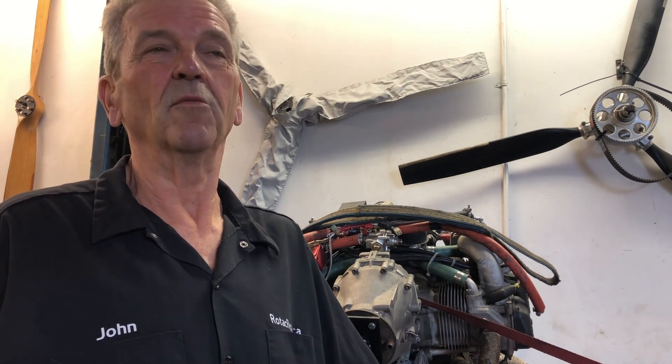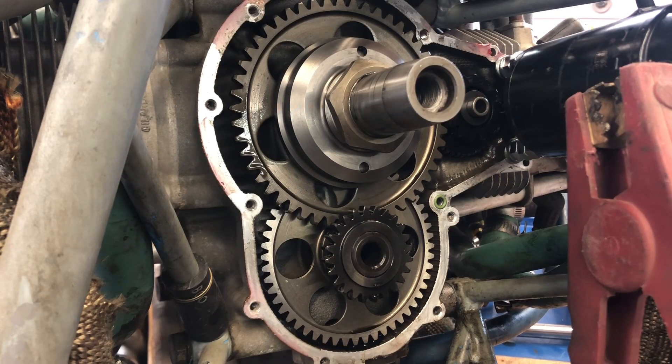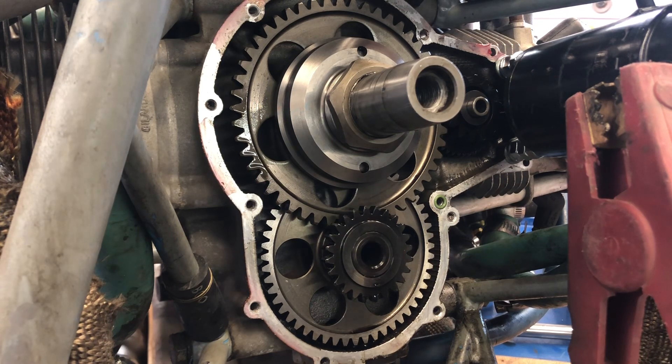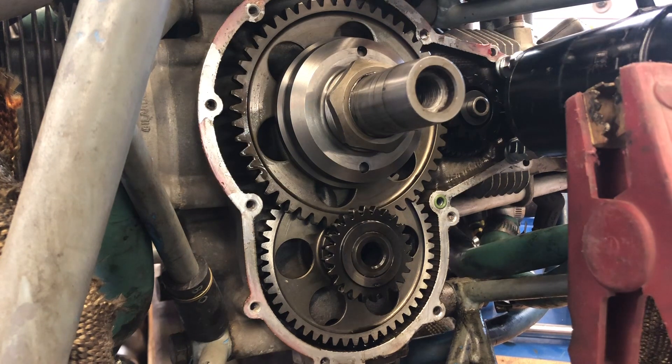It's only a little bit more work. I'm going to bring it back to the shop and inspect it. Once in the shop, I've taken all the ignition off — everything is exposed. There's a lot of wear on the teeth on the intermediate gear back in here, and also on the starter shaft. So I have a booster battery hooked up to the starter, spaced as it would be when operating on the airplane. Let's engage the starter and see what happens.